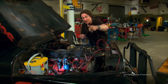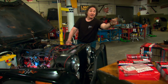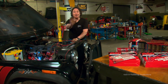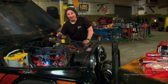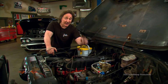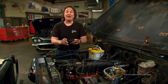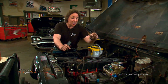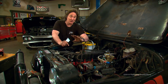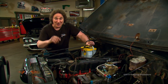When making your final electrical connections, you may want to consider updating the old ignition system with a new distributor, coil, and ignition box, because those will do wonders for making the engine run better. That's all there is to putting modern fuel injection on a classic Jeep engine — pretty simple. If you're concerned about tuning, don't be: just push a few buttons on the calibration wizard, start the engine, and the Sniper will self-tune as you drive. Once you experience the convenience and performance of fuel injection, you'll wonder why you messed with that old carburetor for so long.